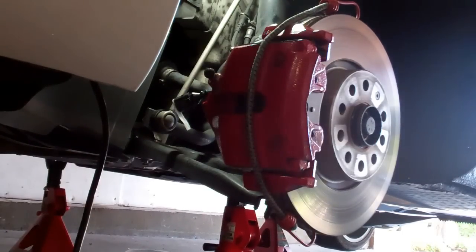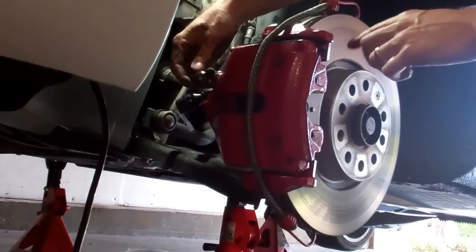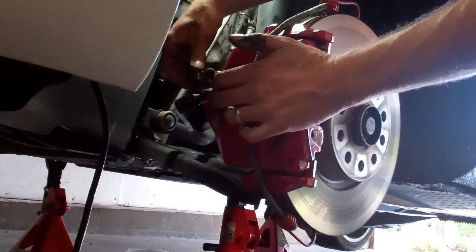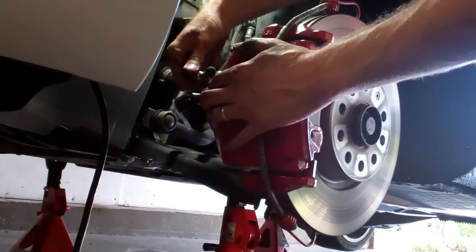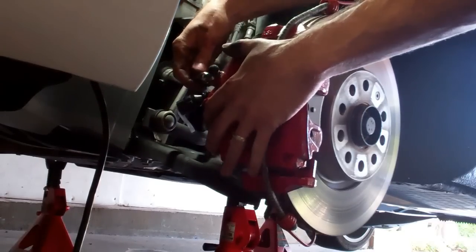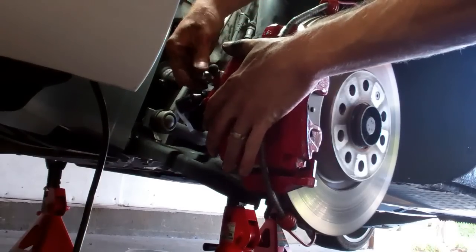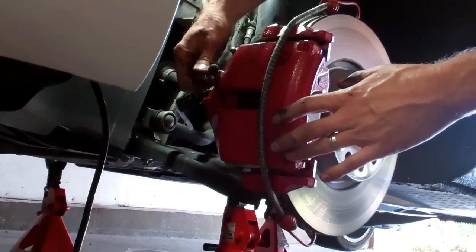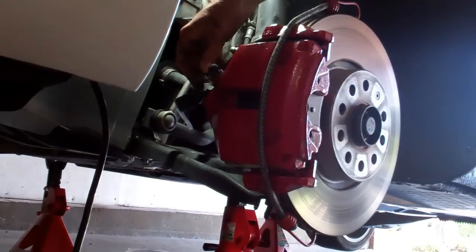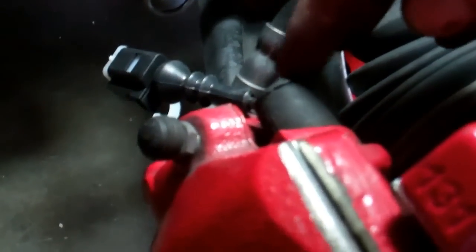This is really a pretty minor brake job. I mean, you can do rotors, you can surface the rotors, you can even take a scuff pad on your rotors and get rid of the glaze on those. But everything has such low miles here — it's just kind of throwing in the pads, keeping it real simple. You do want to shuffle your caliper around until your bolts grab. I got that top one in — just shuffle it around so you can get it started, only by hand of course. Do not use a ratchet — you don't want to strip any of this out. Don't forget to put your caps back on.